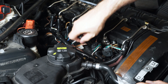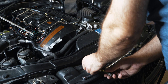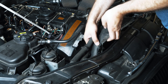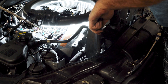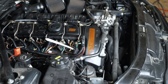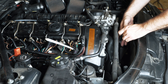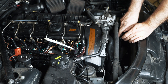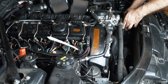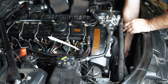I'm going to pull the radiator fan to get access to the crank pulley. Now we can grab ourselves a 22mm and put it on the crank pulley to rotate the motor over. You can see it coming up — it feels like it wants to go back down, so that should be top dead center for cylinder one.